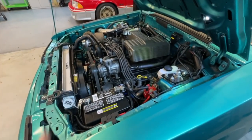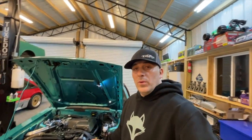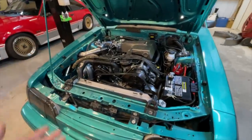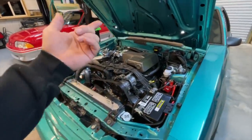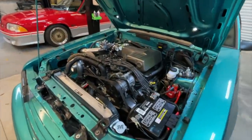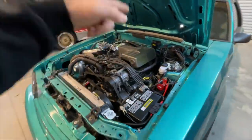What could it be? We knew we blew a head gasket, so we could have damaged something. The pistons checked out, the rings looked fine, the cylinder walls looked fine — I think the bottom end of the car was not hurt. When we pulled the head off we found part of the head gasket wedged between the valve and the valve seat. I looked at the valve seat, pushed the valve down, didn't see any damage — but it could have warped a valve or messed up a seat. Internally the car sounds fine, no knocking.